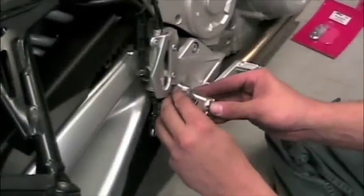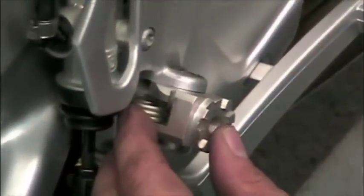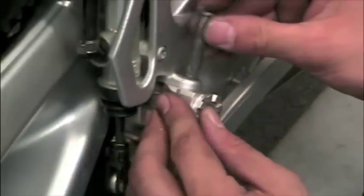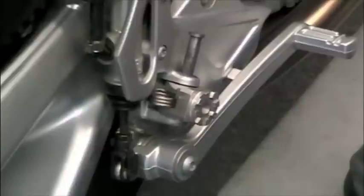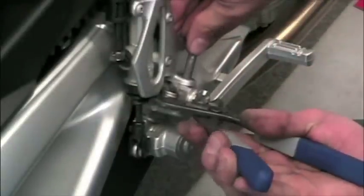The MFW Wolf setup, which we see here, is slightly different. First up is the mount, which actually installs in place of where the traditional foot peg would be. It slides in, spring goes in front of it, and the retaining pin goes right through it with a circlip on the bottom. Note the tool that we're using to compress the spring.